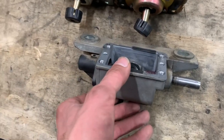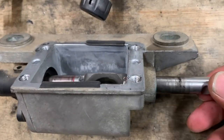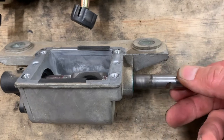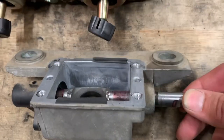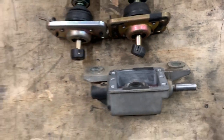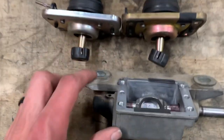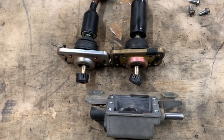Something else I noticed when I took this apart was there was a fair amount of dried grease on the shaft itself and it wasn't moving front to back very easily. So I went ahead and cleaned up the shaft and then just threw a little bit of axle grease on there to make it nice and smooth, which it is now. Basically I'm just going to drop this back in — it drops into this little cup right here and then bolts back down and then goes back in the car.